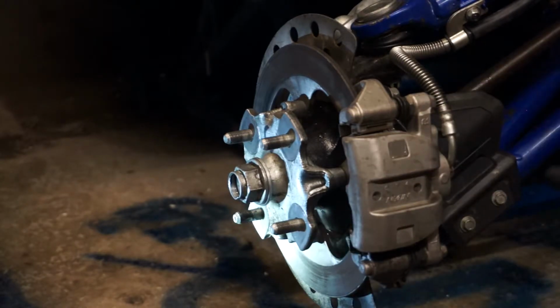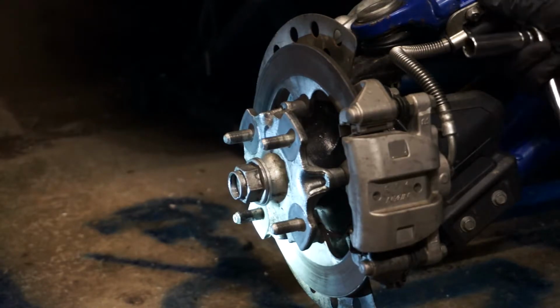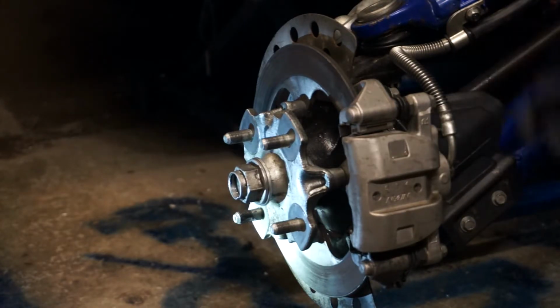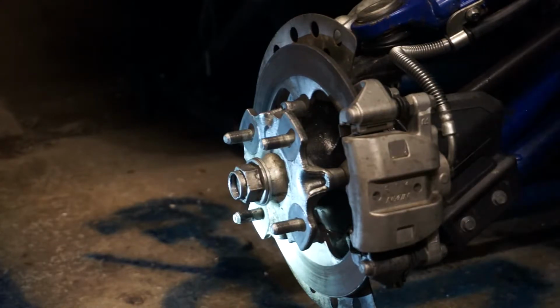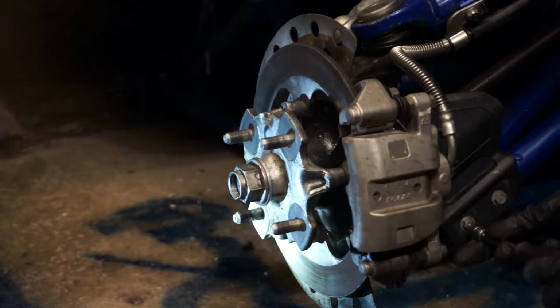I'm now going to remove that 10mm, that 10mm and this 10mm. That one's fastening the brake pipe onto the top wishbone. That's the protector for the CV gator. And they are definitely 10mm. So I'm going on to quarter drive. Always helps if you actually get the correct socket. Definitely 10. The one I was trying to put on there was a 9.